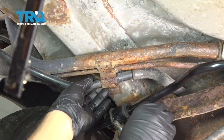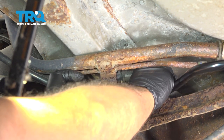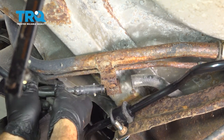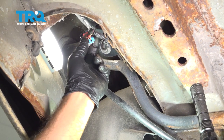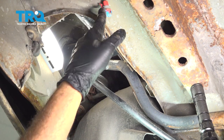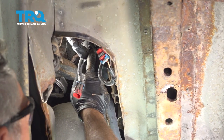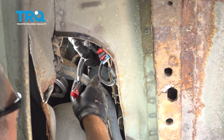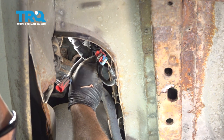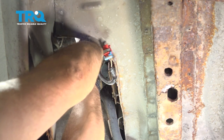We want to go ahead and separate these two here. Go ahead and pull that out. I'm going to go ahead and locate your connector here for the sensor. Lift up on that little tab and pull the connectors apart like so. Now you want to go ahead and reach up here in this canister unit — our solenoid has a little metal mounting tab on it. We're going to use a small pocket screwdriver, insert it between the metal tab and the unit, and try to work that unit off that mounting bracket.